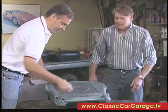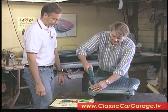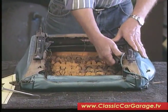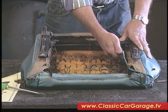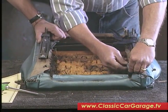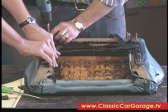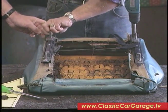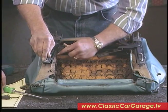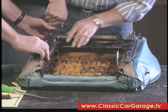Next is to remove pretty much anything else that is on this upholstery — you take the seat stops off here. You have a spring right here that you want to remove first, because you're going to have to be going back and forth and you don't want that in your way or to spring back on you. Then you remove the seat track — this track comes off with just four screws, pretty easy. Then you slide the seat forward, which reveals the rear screws.